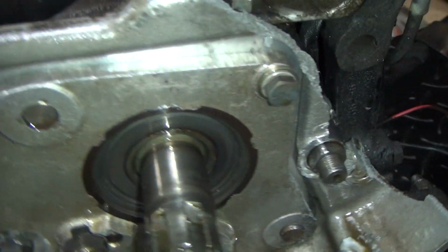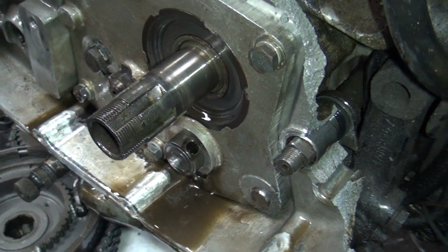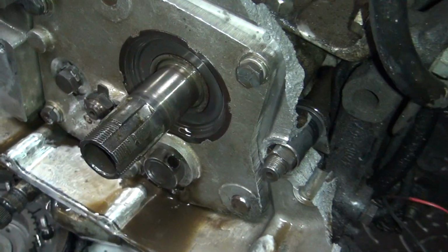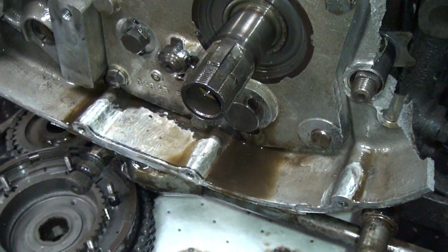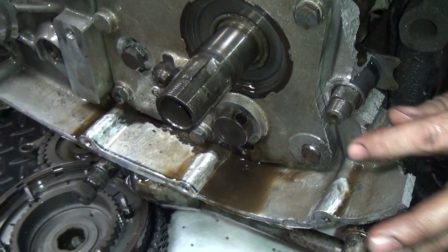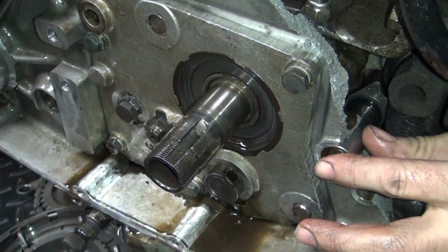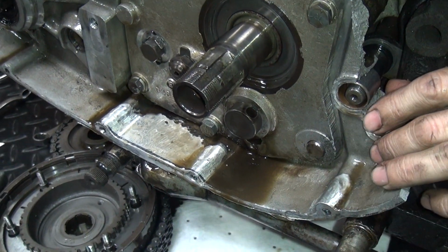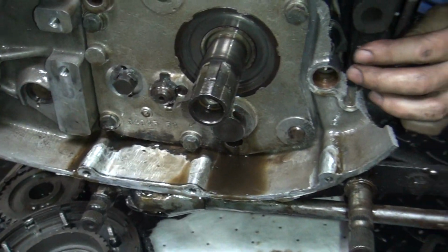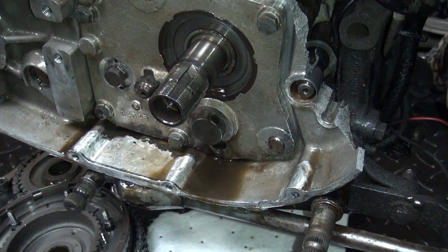But he was having problems slipping out of gear and jamming, but that would put some force on the gear teeth. Yeah, but I don't think it'd be enough. This kicker shaft has not moved. It's still in the bushing. That's not what broke it. Look, the bushing is still good to go. I know. I didn't say the shaft got hit. It's over in the kicker gear location. Anyway, it's broken, so it doesn't really matter. We can interpret what the problem is all day long.